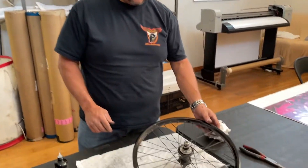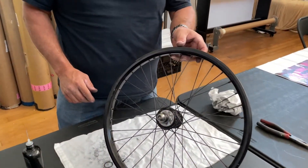One important thing we all have to remember is never to put grease in the Profile hub — no white lithium grease, no wheel bearing grease, no tacky grease at all. Just some clear oil like Tri-Flow is all you need for the hub itself. Again, Gus at Profile Racing — thanks for watching, we'll see you next time.